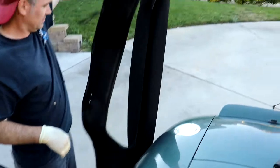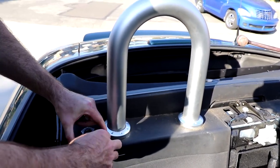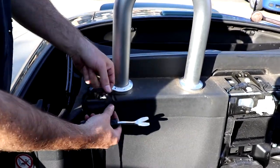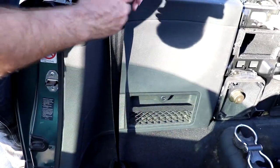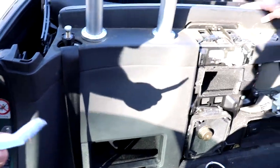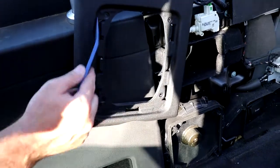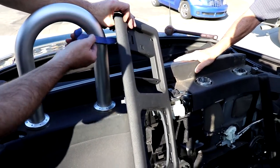To access the screws in the back it's just impossible with the hoops in place, so pull the interior apart — take the seat belt out, get the little clips that hold the seat belt frame, and then we need to take this trim piece off. It's kind of a pain — it has six clips (one, two, and then down the bottom) plus four torx screws that you can see clearly right here. Once you get the four torx out, you have to pry strategically. It's basically even with this piece right in the middle of the upper part, and it's tight.